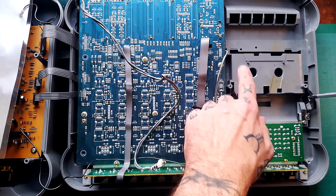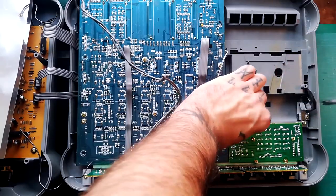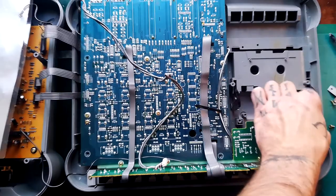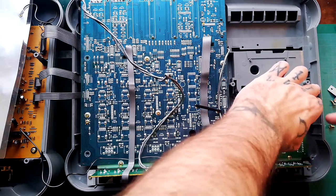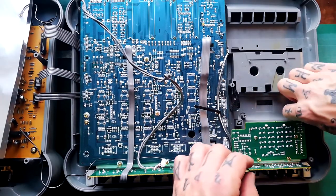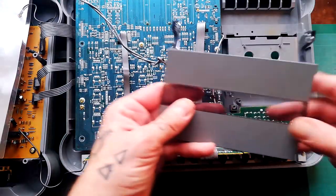I'm going to remove this door. It's not strictly necessary in my case because the door doesn't seem to be broken, but it will make it slightly easier to clean and at least you'll get to see how it's done if you need to take it out to be fixed. There's a screw clip here, and it looks like we've got a spring on top as well on this side — a leaf spring with the angled part pointing downwards towards this side of the door, so that's the top right corner as you look at it from the front. I'm going to remove the screw, come off and lift that up, rotating it through on the far side, and then that comes away.